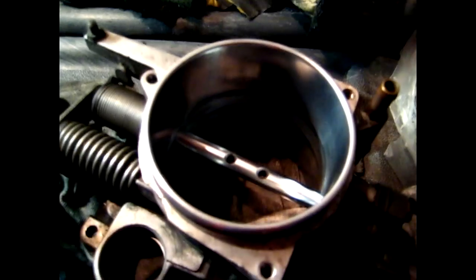You just put a little bit of compound on the cloth and rub it in. The cloth may turn black after polishing aluminum — that is just to show you it is working. When it starts to turn black that is no big deal, you just keep rubbing back and forth, and the more you rub the more it turns black. Once it starts getting harder to work with, just wipe it away and you can see what the surface looks like underneath. After you finish with the metal polishing compound you should have something that looks like a pretty much perfect mirror within the inside.